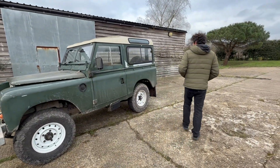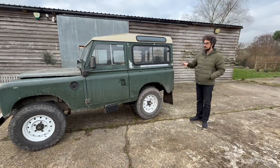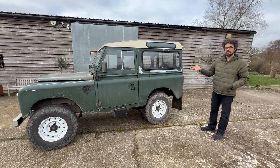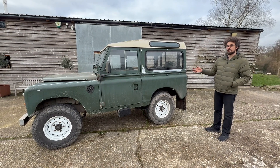Underneath it's got our Tesla Model 3 conversion. It has all new running gear, so it's running on Defender Axles, running Defender Disc Brakes, it's got all new Parabolic Springs, the steering box has all been rebuilt — so it's as new and as good as it can be for a Series 3, so that it can take the Tesla Model 3 power.